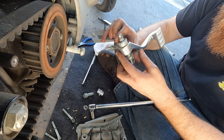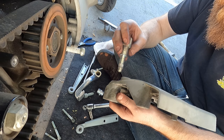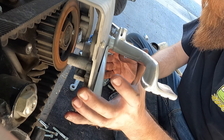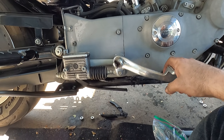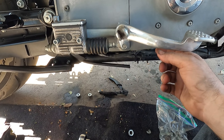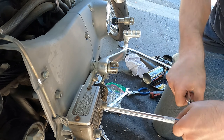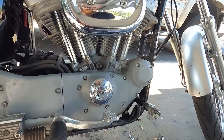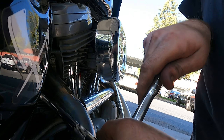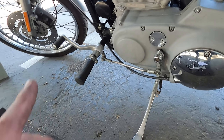So this is the new — well, new but old — little assembly here. It looks like if you had controls there, you'll have a cotter pin. If you didn't have mid controls, then you won't have the cotter pin. Got the sprocket cover on, haven't tightened it down yet but it's on. This looks a little low for the brake — I've got to see if maybe I can turn that threading to lift this up a little bit. Peg and brake mid controls completed on the right side. Let's get that exhaust back on. Exhaust is all bolted up. Now we're going to get started on the shifter side.